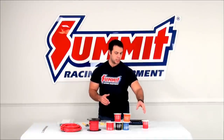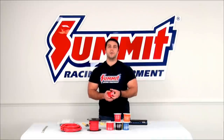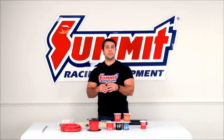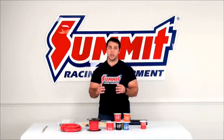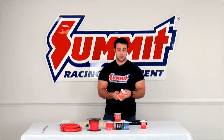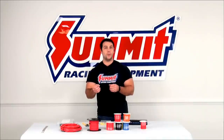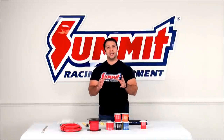The last bit of this video, I want to talk about some of the different wire that Summit Racing has as well as some of the tools and equipment that can make wiring your vehicle a little easier. Summit Racing has a lot of different wire sizes, from your 16 gauge wire up to your 1 gauge wire, depending on what your accessory needs in terms of the distance from your power source as well as the amperage that accessory is going to be drawing — so make sure you refer back to our chart to get that proper wire size. Summit Racing also offers a lot of different colors of wire. The reason wire comes in different colors is it makes troubleshooting a lot easier. If you have black wire run everywhere, you're not going to be able to quickly identify which wire is going to your electric fan and which wire is going to your fuel pump. The different color wire really helps shorten troubleshooting time.